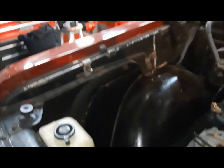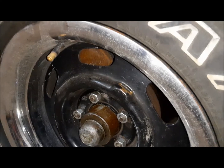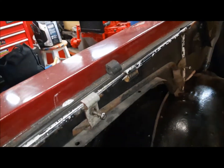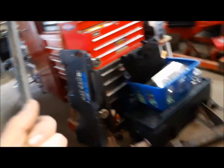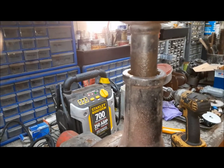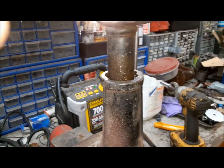On these old Dodge trucks, the stuff for the spare tire — there's the crank for the jack, the lug wrench, and the jack stows down in there. Good thing we never got a flat tire, because somewhere along the line this truck got new lug nuts put on it. The new ones are 13/16 hex, which Chrysler never used — Chrysler was always three-quarter hex. So I checked already — this lug wrench would not work. I found one in my collection with a 13/16 lug, so we're going to swap that in. The other problem is the jack is seized, which is pretty common on these trucks because it lives under the hood. I've been pouring PB Blaster in it for a couple of days and that hasn't seemed to do anything, so we're going to try a little heat and see what that does.